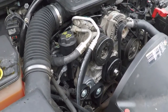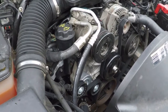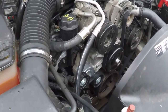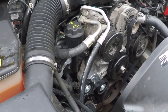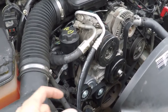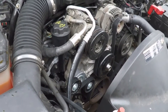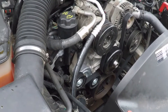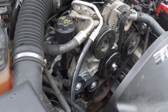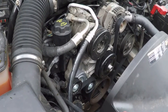That sheared the gear off the front of the balance shaft, and ultimately that's why the bolt ended up coming out. So the balance shaft was destroyed. That shock apparently is what broke the tensioner shoes on the side chains. It also moved the alignment of the gear on the idler gear in the center — I showed it in the timing section. On the idler gear there's a back gear that drives the balance shaft; that gear is pressed onto that idler gear assembly, and then there's a roll pin that goes in there that holds it in time. That roll pin sheared and rotated that gear on the idler assembly by about 20 to 25 degrees. So we had to press that off, realign it, press it back in, and put a new shear pin in it. That's been resolved.